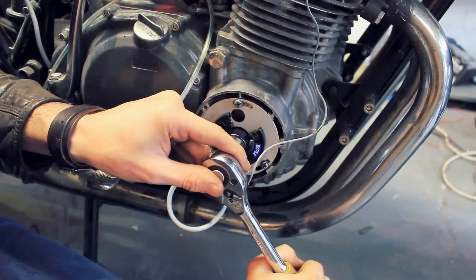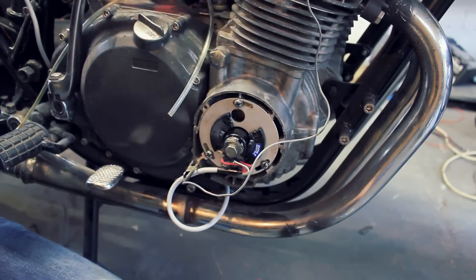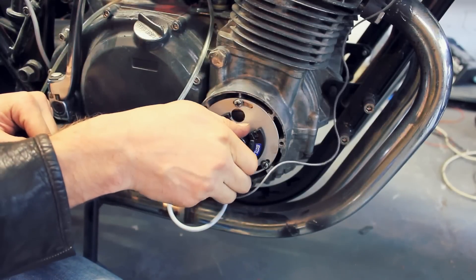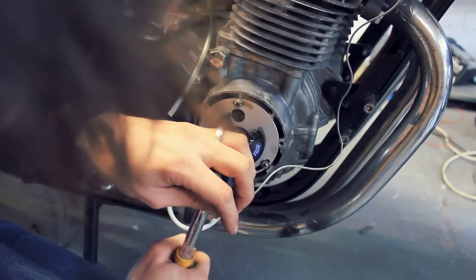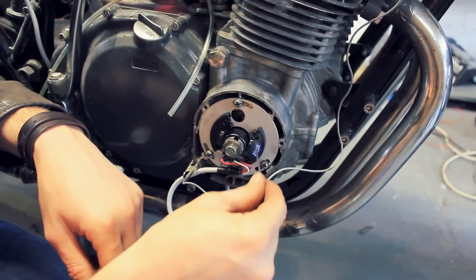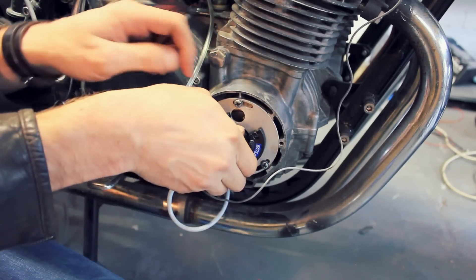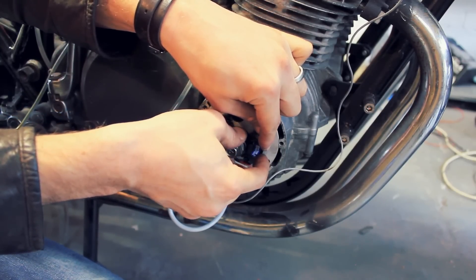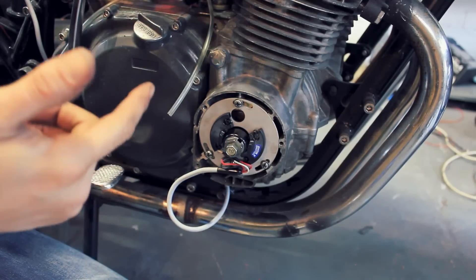That's set there - let's try this on with the firing mark now. And that fires there - perfect! Now we'll go on to points two and three. Twist all the way around to the advanced timing mark, open this out and it's advanced. Push this on a little bit further so I can make sure the light's not coming on any sooner than that. Then using an allen key or hex key size two, adjust two and three so that it closes. Just about there - tighten these up - perfect. Next thing to do: put the tank on, put some fuel in, let's see if it works.